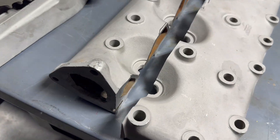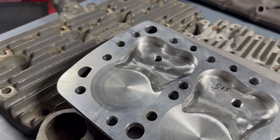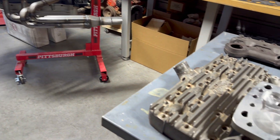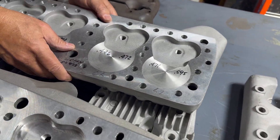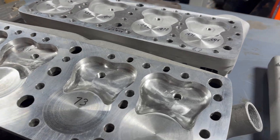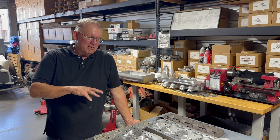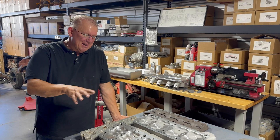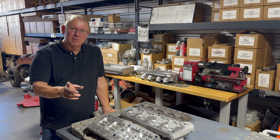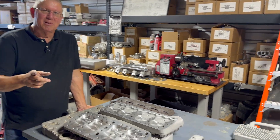That's an example of what can be done — be careful about knowing the thickness to the best of your knowledge. This one's ready to go — we'll be putting it on the '59 AB engine I'm building for the white car. Those chambers started out pretty small, and the machinist was reluctant to machine them actually. So that's kind of what it takes to go from a 66 cc to a 73 cc head. Thanks, Steve, appreciate the education. I may someday have to make my own heads because I'm a picky guy — there's a lot of variation between manufacturers, and getting them machined to what I think I need. Stay tuned — we may have some more developments on where I go with recommended cylinder heads for the blower motors that I help people with.